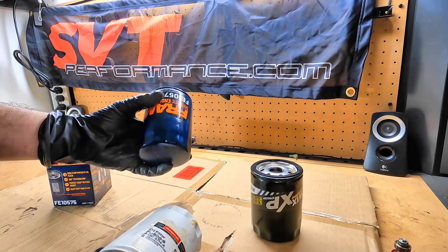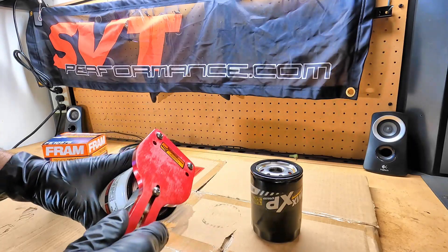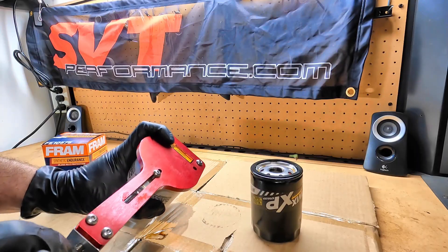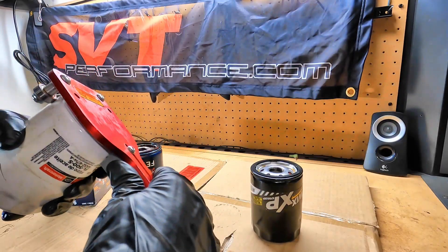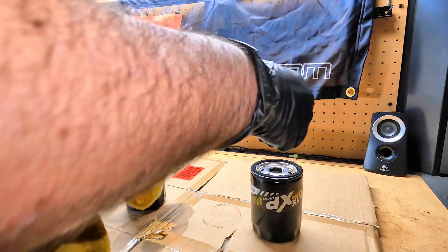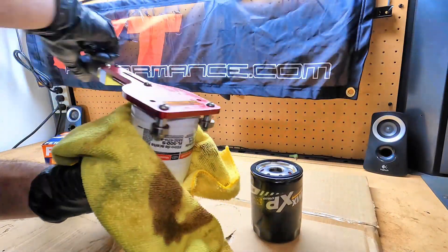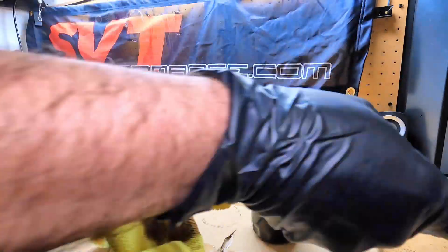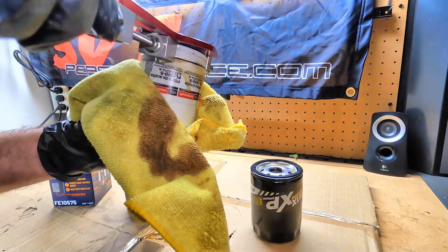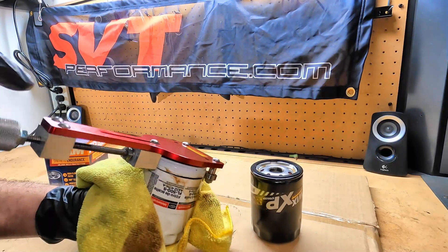You can order these through walmart.com, and I have to admit I've run some too because I've seen other people cut these things open and they look pretty good inside. This is the old standby FL500, what we've been running on Coyote Mustangs since 2011 when those first came out. These are all the same thread pitch as a Motorcraft FL820S — the FL500 was just sort of a downsized version of it.